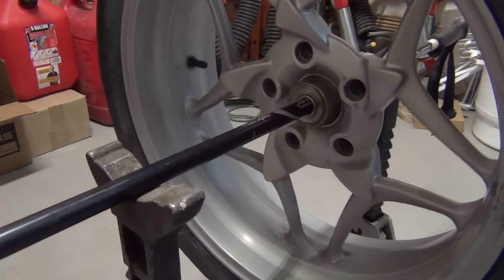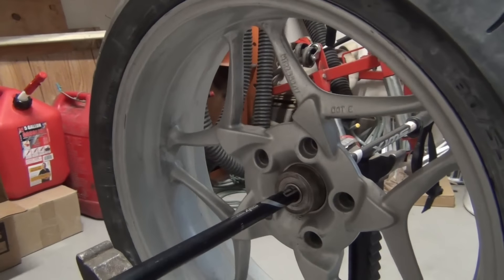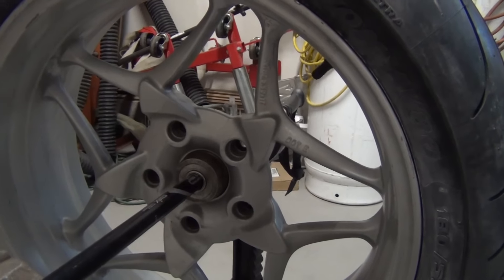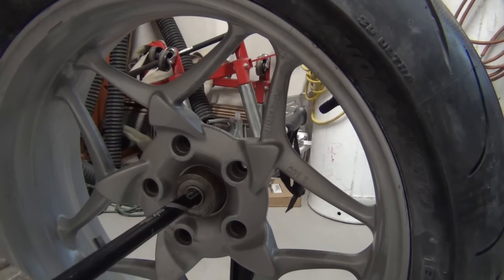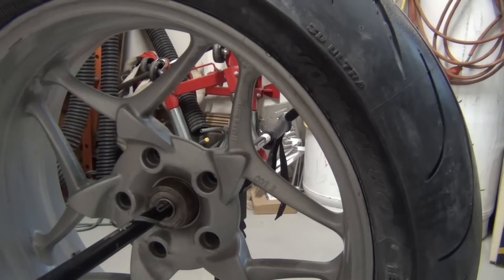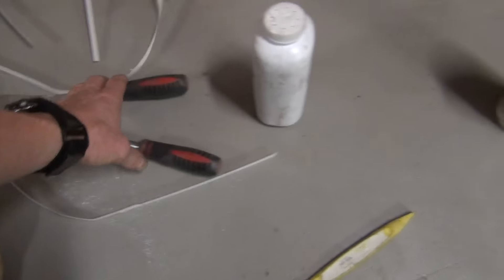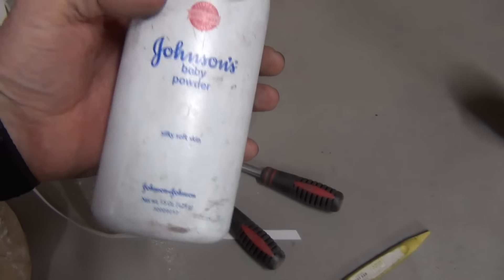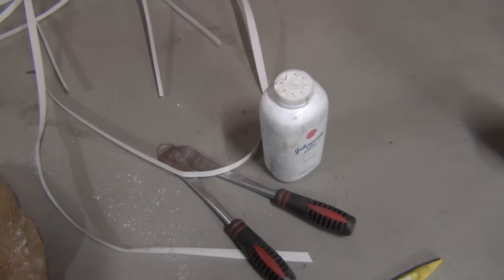Pretty good. It's thinking about it, and that's it. If the tire can move that slow and you're random, I think you got a pretty good setup. So the way I did this tire is the way I've done other ones — I'll put links to my other tire videos in the description. I just did it like a dirt bike truck tire, but being careful, I used baby powder as a lubricant. That seems to work ridiculously good.